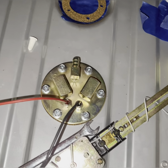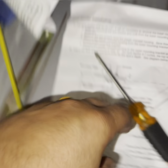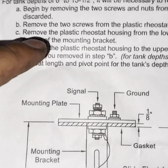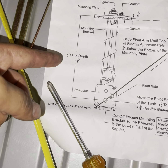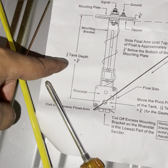It's not a hard installation at all. The instructions on this one aren't great — this is the first issue I ran into today. It tells you to remove the bracket, remove the screws on the back of the housing and save them, then reinstall the plastic rheostat housing to the upper mounting bracket and secure the screws from step B. For tanks six to seven inches, the top screw is not needed. Adjust the float length and pivot point. It says to base it off a diagram showing half the tank depth — I went with half tank depth.